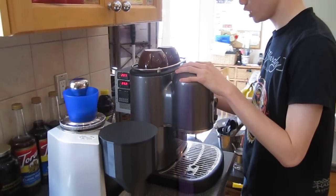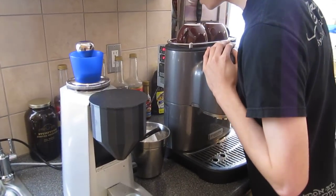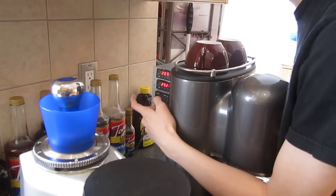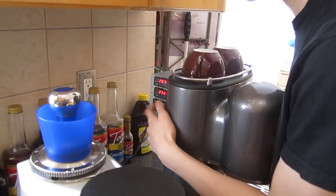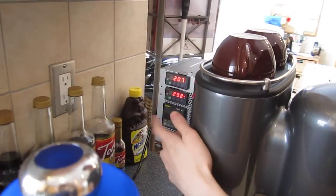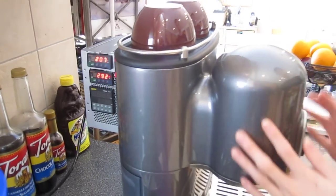This is actually a dual boiler machine. I added two PID temperature controllers and a digital timer right here. I can change any of the parameters of these controllers — I can change the temperature and the time that the pump is initiated. All these are controlled by relays which complete the circuit when needed.